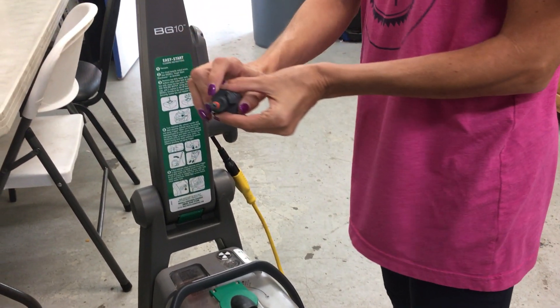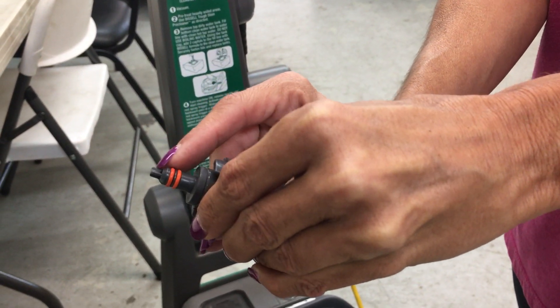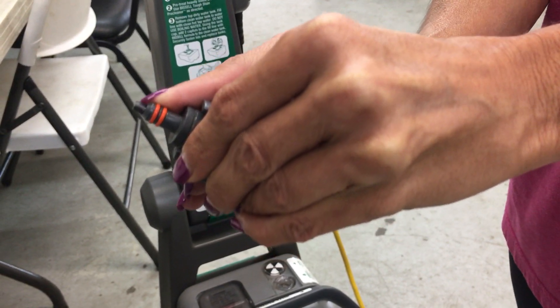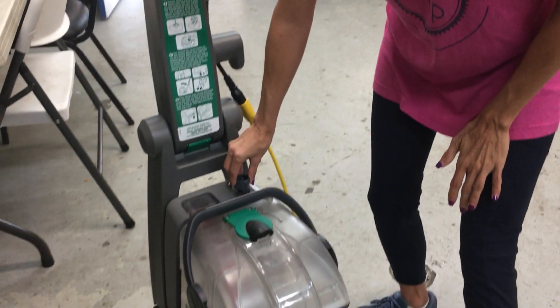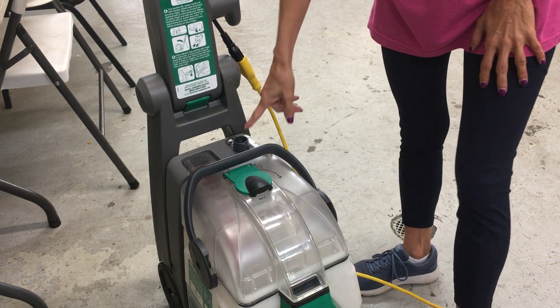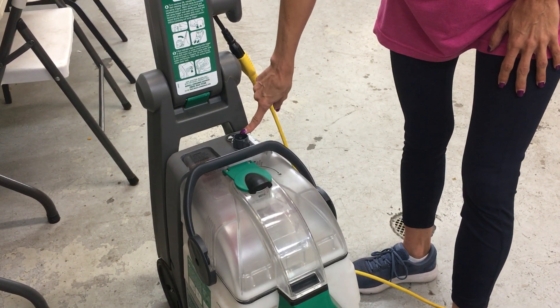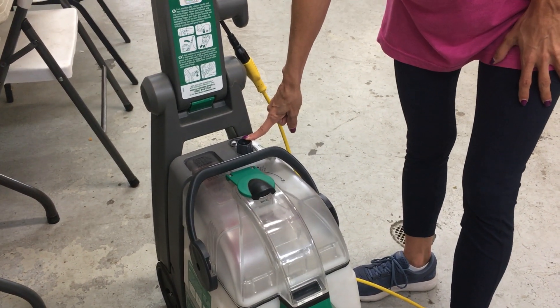This piece right here can be broken off on even the first insertion. If you do that, you are breaking your hose and tool and it will not depress that auto load gasket and engage. But if you break this off of your tube and leave it in there, every time you turn your unit on you will be receiving a solution bath.